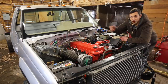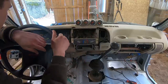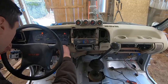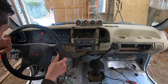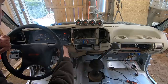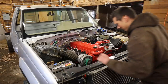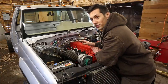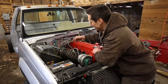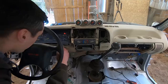I haven't installed the radiator or any of the cooling system including antifreeze, so I won't be able to run the engine very long anyway. I have all the gauges installed except for the oil temperature gauge which isn't hooked up yet — but the others are hooked up and the tachometer should work. Let's give it a try. That's run — the wait-to-start light is coming on, which is a really good sign because that's controlled by the Dodge PCM. Low coolant light is on — that's expected. The engine might not have any fuel in it so it might have to crank over a bit — I might also have to bleed the injectors. As for the exhaust, I don't have a downpipe installed — it's just the exhaust brake off the turbo. I tried fitting the Dodge downpipe but it didn't quite fit, so that's going to require modification in another video.